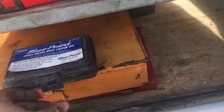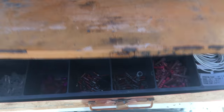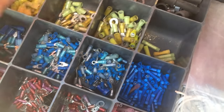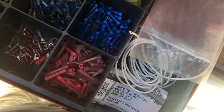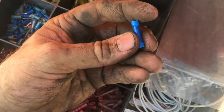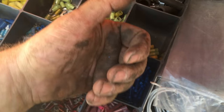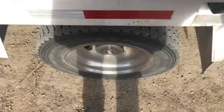This is a Blue Point sheet metal hole cutter kit that I've never used — they're all brand new. I thought I was going to use it and never did. This is my assortment of electrical connectors. I don't use cheap stuff — I use the higher-end connectors that have heat shrink built onto the back. The better ones are a semi-opaque color, made out of nylon, and they work better. The cheap ones you get at AutoZone or O'Reilly — when you crimp them down the insulation splits, which is not good for electrical connectors.